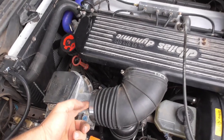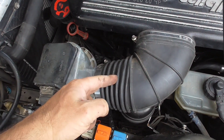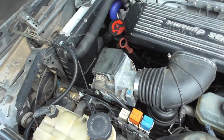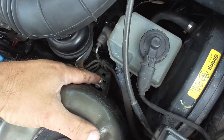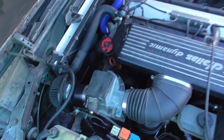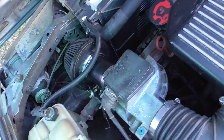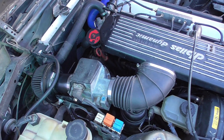There's a rubber spacer in here that allows this intake boot to clamp properly on the airflow meter, and I made a bracket so it holds everything. The power steering reservoir has to be moved — all I did was unbolt it and push it down, and it's not moving anywhere. I managed to make an air filter system on it. I don't like the fact that it's basically a hot air intake, but that's what I have to work with for right now until I make a better one.